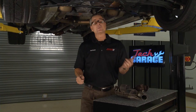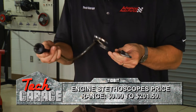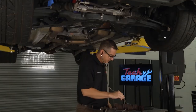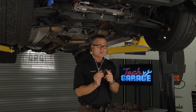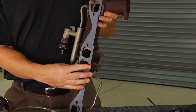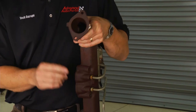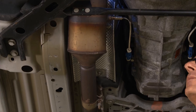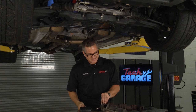All that's left is doing some exhaust testing. The first thing you can do is check it for leaks. You can get one of these stethoscopes — go down to Advance or any parts store. Pull off the part that checks for vibrations, put it in there, and run it along the exhaust system. If there's a leak, it'll be real audible right through this hose. A couple of other spots that leak: the gasket that seals the exhaust manifold to the head is a good place to find a leak. Also right here where the donut gasket seals the manifold to the downspout — that may be leaking too. You can also just get a rubber mallet and tap the exhaust system — if it sounds loose, there are some vibrations. Check and see what's going on; it may be the media inside the catalytic converter.